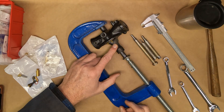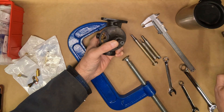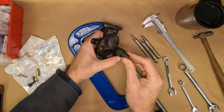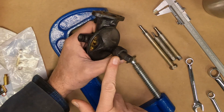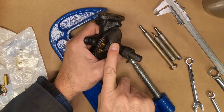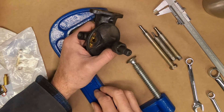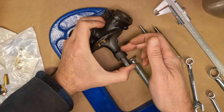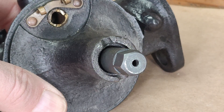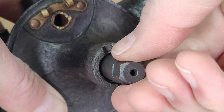You may also need heat from a torch, and it's also often required to get some impact force down into the threads to crack the corrosion loose from the threads. Luckily the main jet is brass and the housing of the carburetor is cast iron, so you've got dissimilar metals. So they will crack loose and they will come out without binding, provided you can get enough force on here, enough heat, and that impact I mentioned earlier. And once you've got them cracked they'll come out pretty easily.